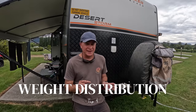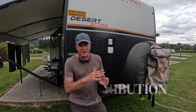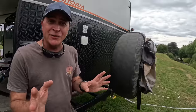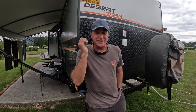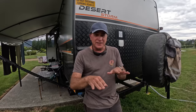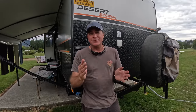Distributing the weight in the van is so important and it is your responsibility to make sure the van is nice and safe. If you have too much weight at the back of the van, it will have an increased likelihood of starting to sway. The back of our van is super clean — all we have is our spare wheel. Make sure you don't overload tool boxes or wood boxes at the back. Also make sure you don't have too much weight in the cupboards — anything really heavy should go on the floor of the van over the axles. Make sure the water in the tank is either full or empty, not half and half — the water can slosh around and play havoc while you're driving.